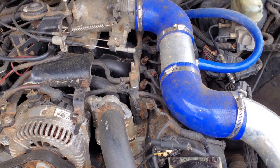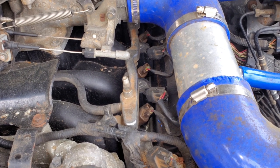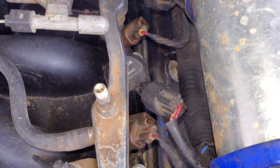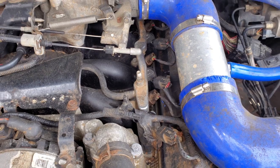So chances are if your fuel pump's bad, your engine probably ran out of fuel — that's how you found out it was bad. But before you get started, push that little Schrader valve right there — that little bicycle tire valve. Push that, depressurize the system. That way you don't have fuel spraying all over your face if it does have pressure.